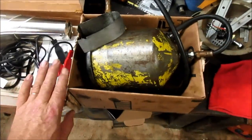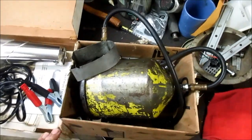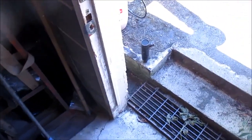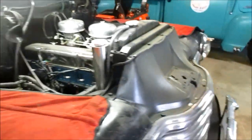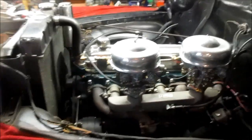So there you go. I took the bypass oil filter off the Chevy, the 216, and I'm going to go ahead and clean him up and get him painted, because I believe I am going to bolt him onto the Chevy. I've got the draft tube out here draining. That's for the PCV modification, because he's got condensation in him. You know, that engine really picked it up. So anyway, that should put a fork in the tune-up episode here.